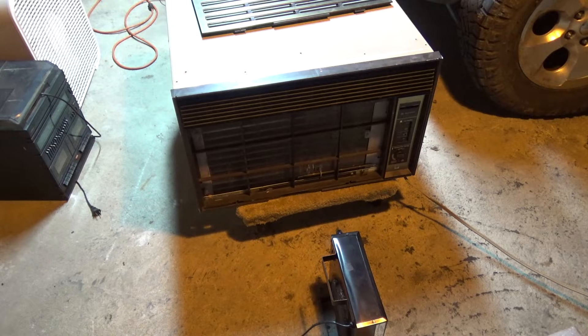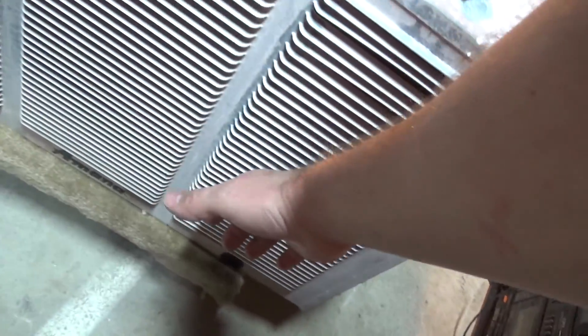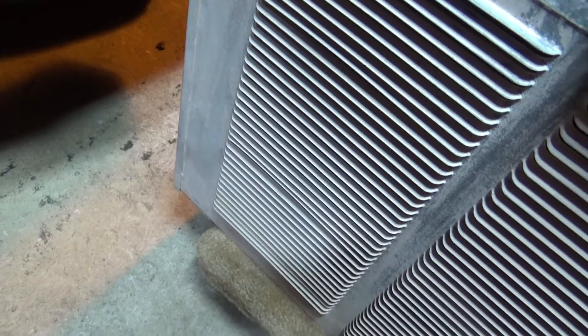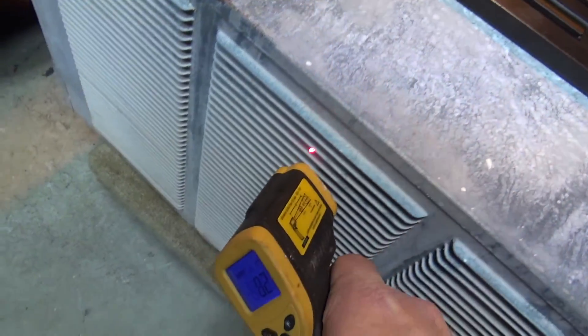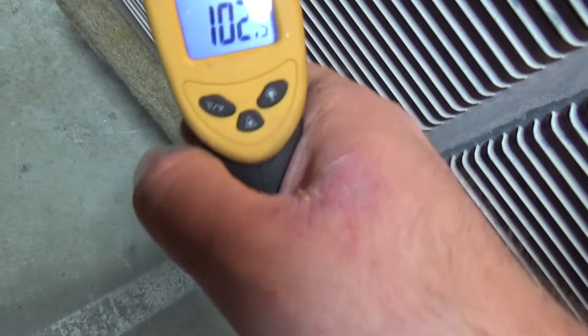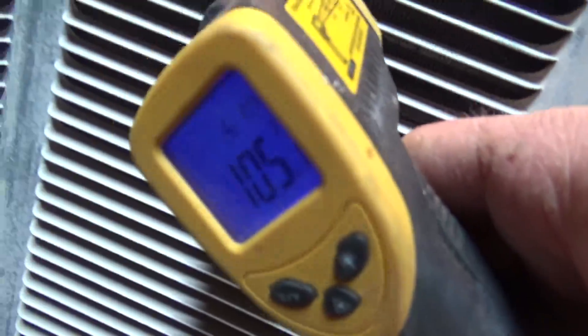I'm shocked that this is working properly because towards the end of last year it wasn't cooperating very well, but fortunately it looks like it's going to be fine. I'm definitely worried about the condenser because it's just not getting good airflow — not anywhere near as much as it should be. Like this one blasts a ton of air off the condenser and this one is just barely even moving. The compressor to me sounds very labored, which would make sense — it's even hot at the top already. So you're only losing a couple degrees — five degrees — that's not much.